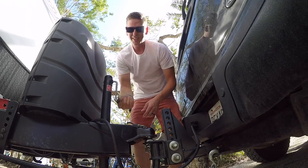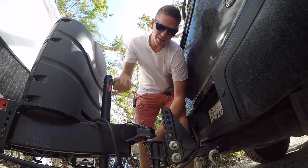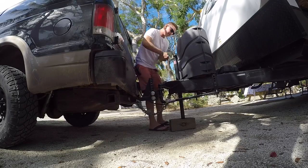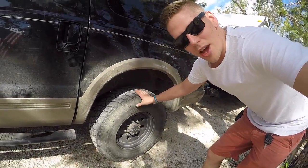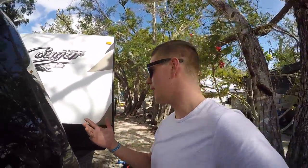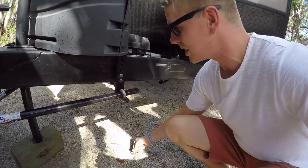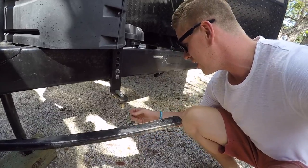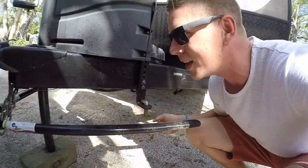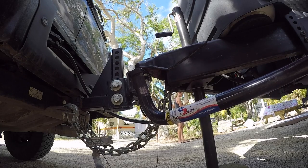You can see my truck is very dirty, sorry about that, but you can see it's lifted way up off the ground — it's basically lifting the whole truck up. That is gonna take the pressure off this bar right here. So I'm gonna take the pin out, slide the bar off like that, put the pin back in so I don't lose the cotter pin, then pull this little guy out and the bar comes out just like that. Do that on both sides and then we're ready to unhook.